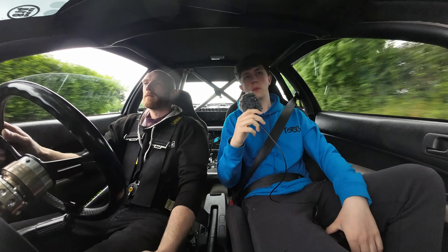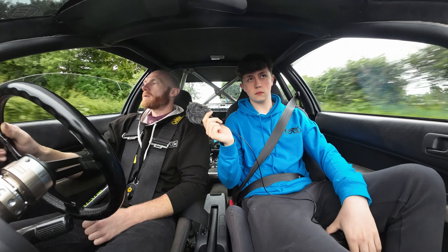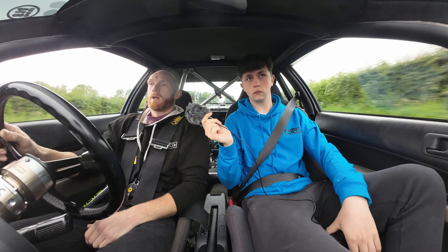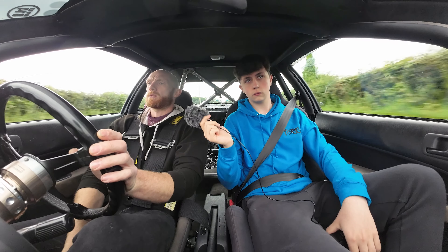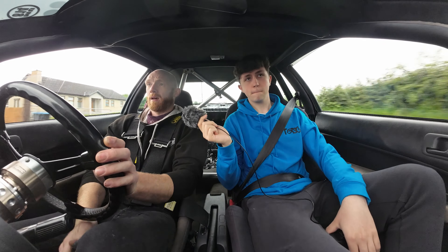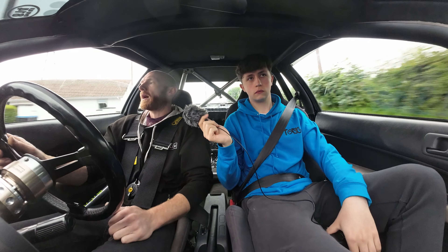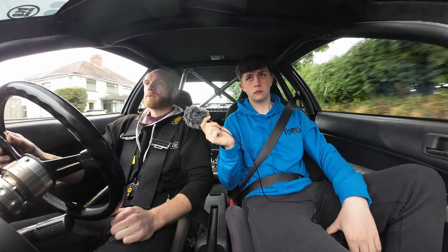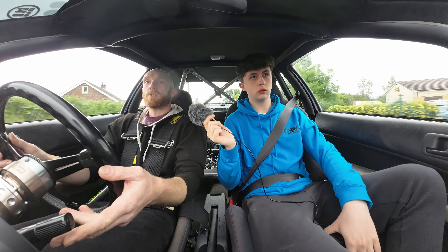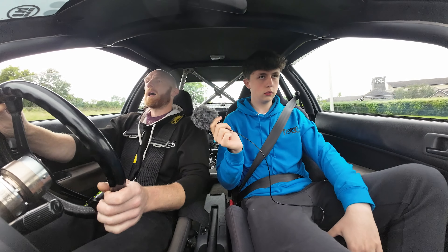It's running a set of Jay's Racing N1 coilovers — circuit and track race coilovers. The spring rates are sky high: 18k front and 14k rear, which is way higher than something like Meister Rs or BCs. Bumpy back roads can be interesting and chuck the car around a bit, but on track they're brilliant — the car corners really nice and flat.